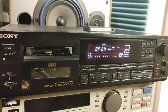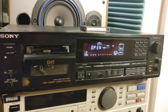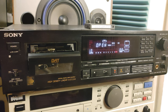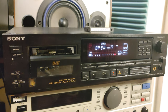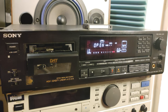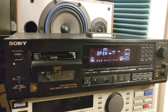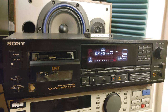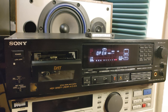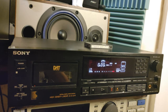The proper way would be opening the cover and using the strips specially designed and manufactured for VCR and digital audio tape recorders — heads, drum heads. You just put some isopropyl alcohol on it and clean it. But another solution would be something like a clear paper — stuff that will not leave any residue or anything on the head. This one is working just fine and I'm very satisfied — it can play a lot of different tapes.